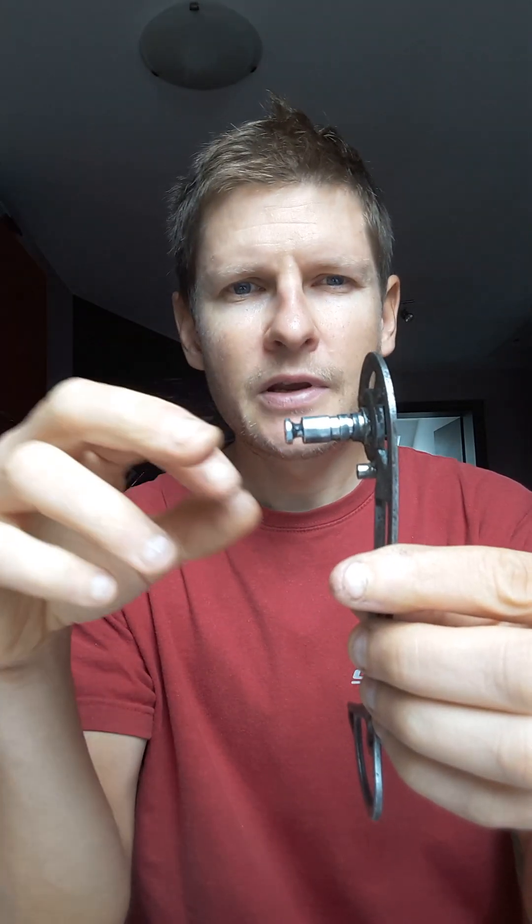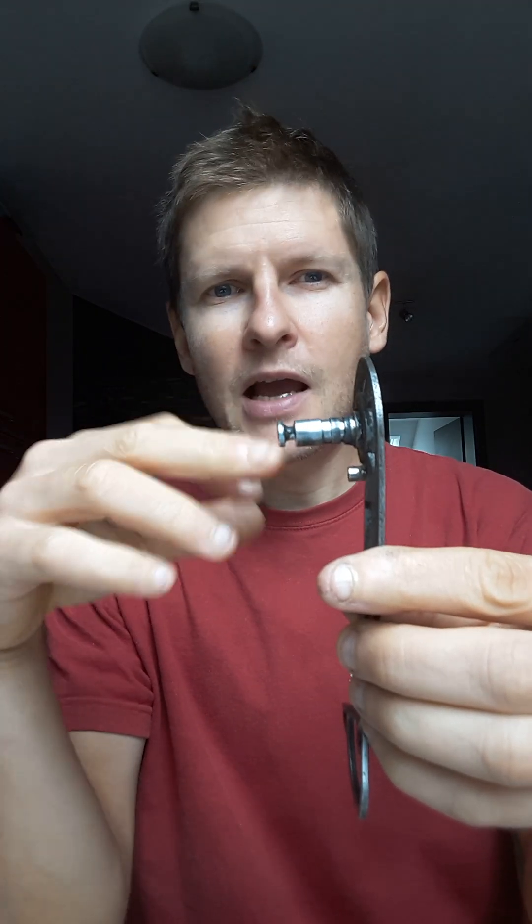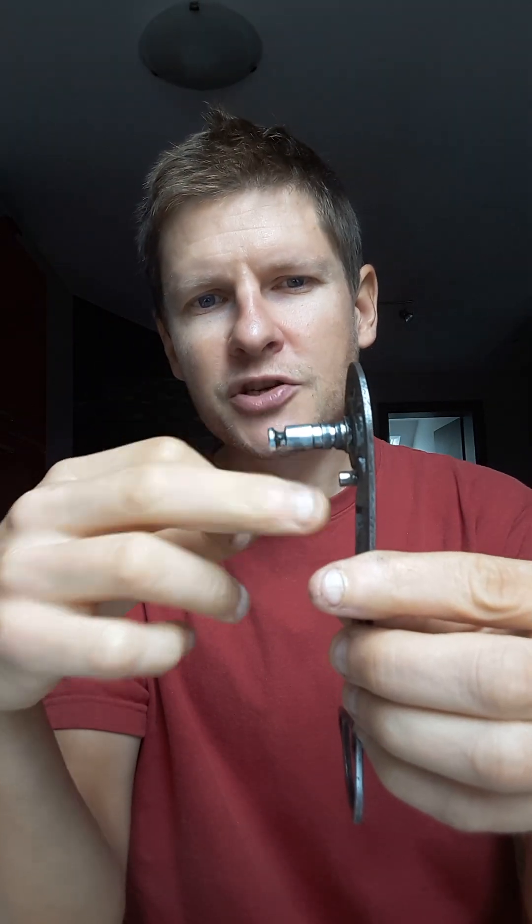Another point: this pin used to be made from hardened steel. Some Campagnolo and SRAM derailleurs had hardened pins. But in the last seven-plus years, these pins are made from soft metal. My personal opinion is that engineers found a cheaper solution — softer materials mean easier manufacturing and less frequent cutting tool changes.